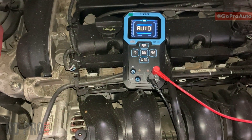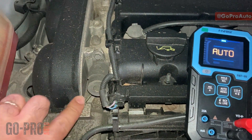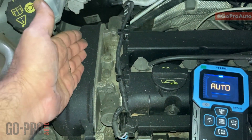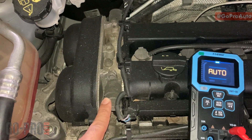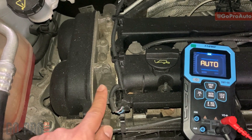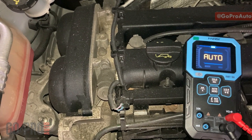Welcome back. In this video we're going to look at this variable camshaft timing or VCT actuator on this Ford Fiesta — what many other companies call a VVT solenoid. On this engine we have two variable valve timing mechanisms or VVTs. This one is on the intake side, and this control valve and solenoid valve is going to control the operation of this VVT. If you have any problem on this solenoid valve, it's going to affect the timing adjustment on the intake camshaft, which is going to affect engine performance.